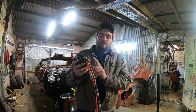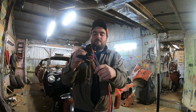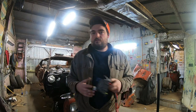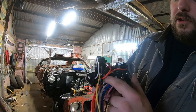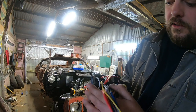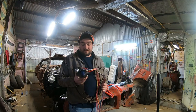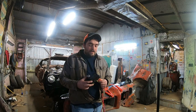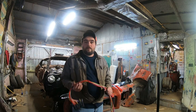If this wasn't garbage, you would have these wires come back a little further or route everything out the bottom. As it is, we're gonna have to make some standoffs or something. The second real big problem I have with these — and why you really shouldn't use them unless it's something you're just screwing around with and you want to keep it as low dollar as possible — is that every single one of these fuse terminals is just a crimp connector. There's no solder in this, and they're all exposed, so you've got to be kind of careful where you mount this. If you're doing something nice, you're not using this. Get something from American Auto Wire or Painless, not one of these.